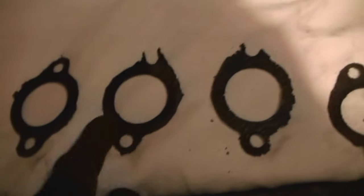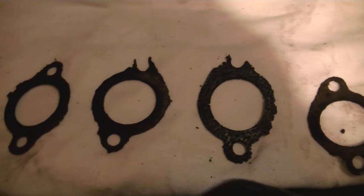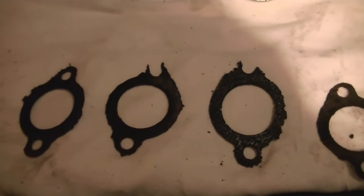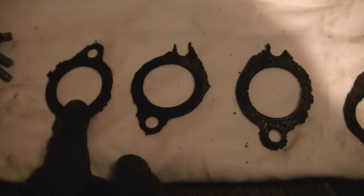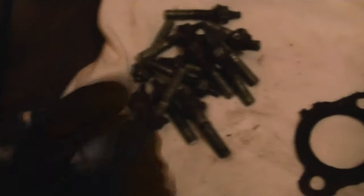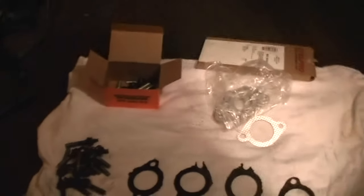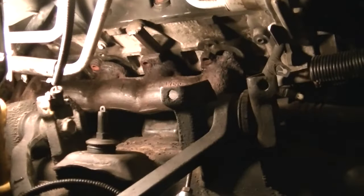You have to buy them individually, especially on this model. The 2002 Explorers and Mountaineers up to around 2010 — the 4.6s — have an entirely different gasket, but up until 2002 they are individual pieces. So I had to go out and buy a kit. It wasn't very much — it was only $13. I also picked up brand new studs and nuts. I had my old ones plus some extra laying around, but I thought for $10 just put new ones in. I would have preferred one big gasket piece, but since no one makes it, I'll just go ahead one at a time and drop them in.